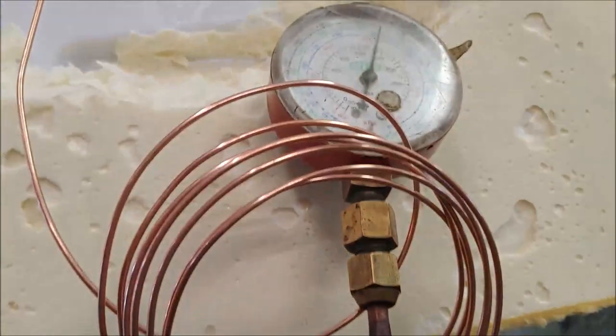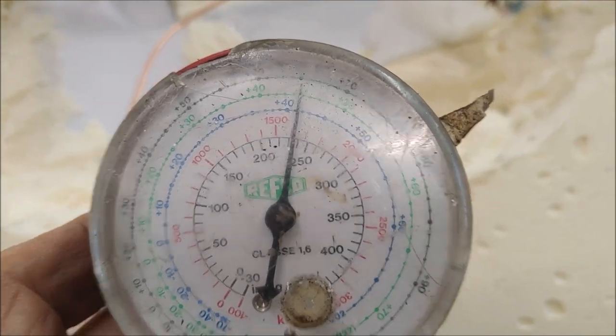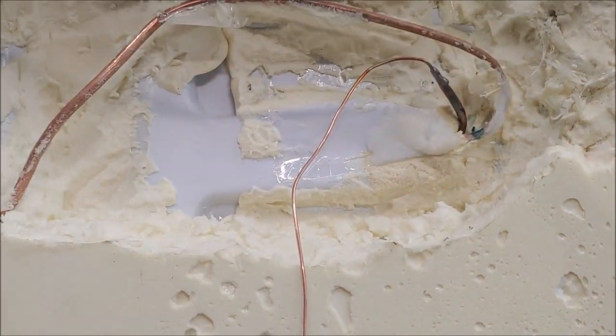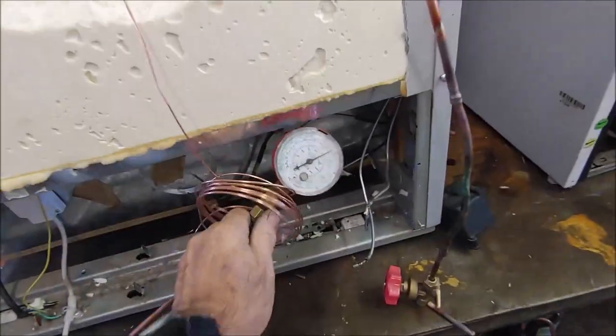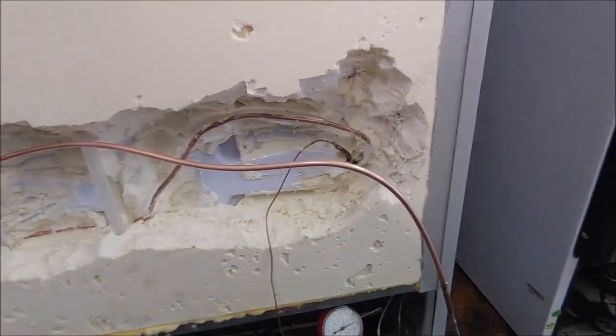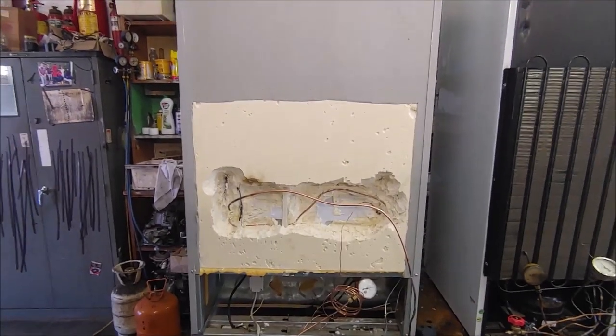It's about two hours later. There are the two pipes on the condenser — the gauge didn't drop at all. I want to double-check my capillary welds, so I've put a service valve on and pumped it up to about 225 PSI, leaving it for about two hours to make sure there are no leaks. About two and a half hours later, the pressure is still exactly where I left it. I can safely say the internal freezer is not leaking and the internal condenser is not leaking. Now I'll take it off the workbench and fit the cold plate from the inside on the top.